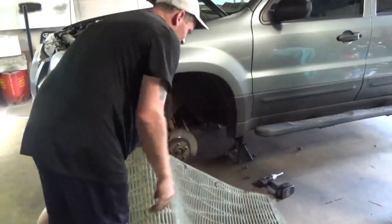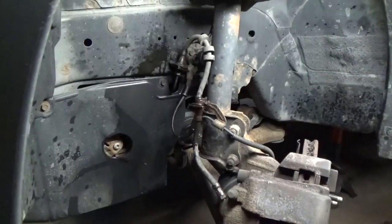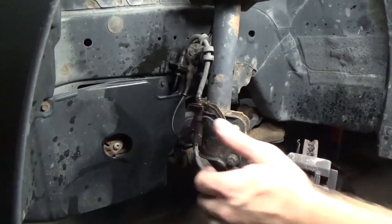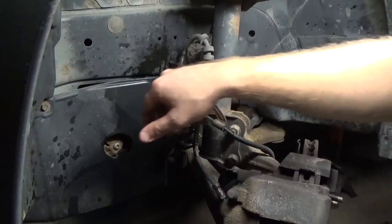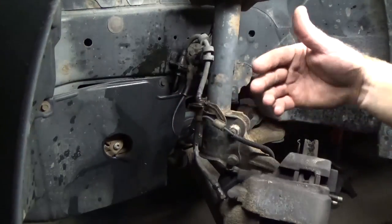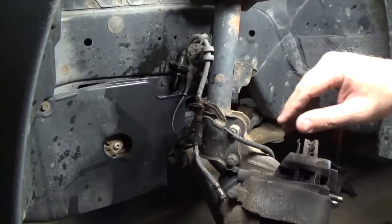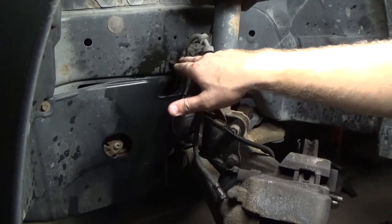These yoga mats work great — I've had that one for about two years and it saves the knees. Now that we removed the wheel, it's real obvious where the leak is coming from — it's this left front brake hose. I got the wheel cranked all the way to the left to give me better access. We're fortunate enough that it is the brake hose that blew and not the steel line, because when a steel line blows you've got to bend them, flare them, double flare them. Today's repair is going to be relatively easy since it is the brake hose, as long as this fitting comes loose out of the hose.